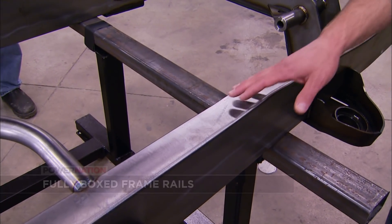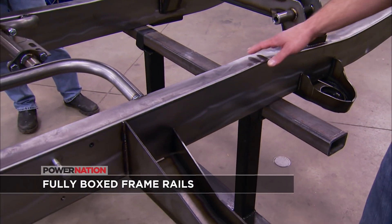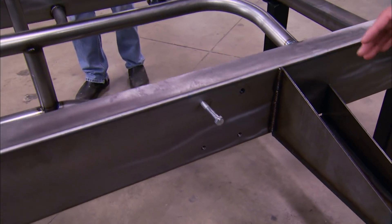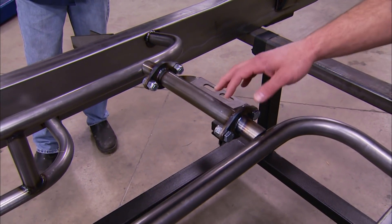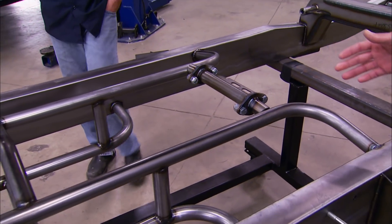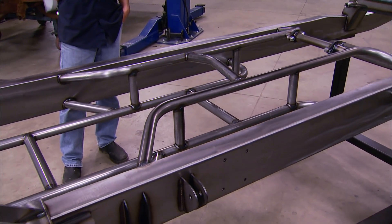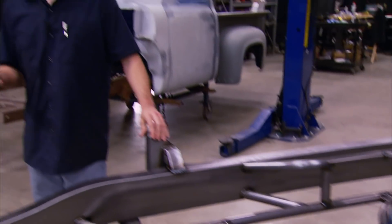Some of the cool features of the frame: it's made out of all 10-gauge steel, TIG welded throughout, and everything's fully ground. They install nuts in the frame for running board mounts. There's a movable transmission mount — just tack-welded so you can slide it forward and back on the tubes to mount any transmission you want. That's affixed to a tubular center section, giving more strength than the original factory frame crossmember. The cab mounts and forward box mount are in OE location — everything will bolt right up.